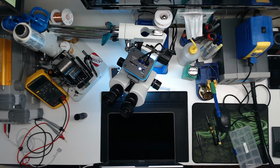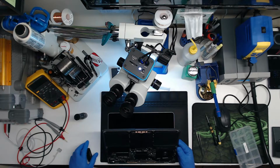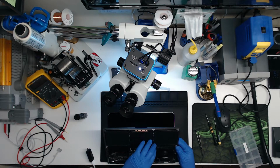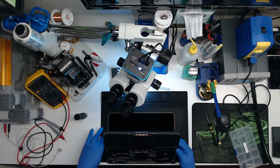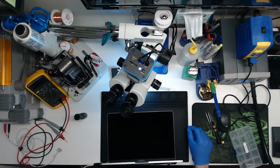It's 20 volts going to... Alright, yeah, it's doing something weird. I'm wondering if the keyboard's messed up too, so we'll unplug that. Unplug the keyboard, and now we just have the SSD, the trackpad, and the LCD plugged in. So let's see if it comes up now. It was going to 20 volts, but it was going down to 100 and something milliamps. So still 500.